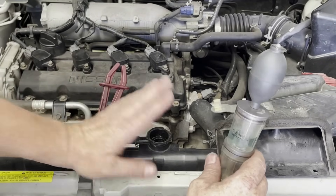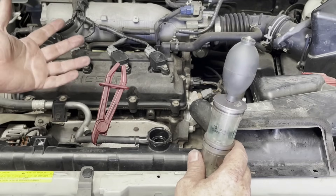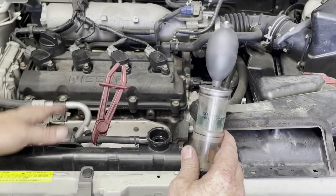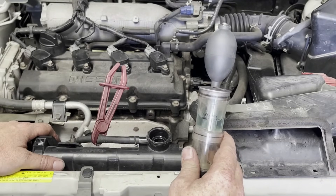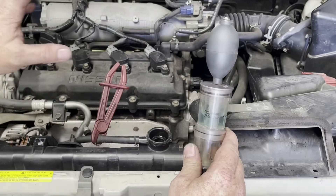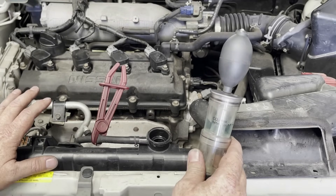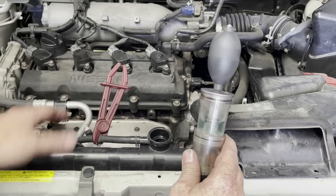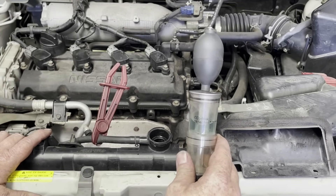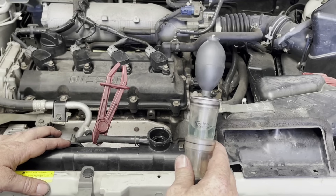In terms of a final diagnosis: it's losing coolant, we have oil that has coolant in it, we have a spark plug that's a different colour, we still have good compression so that means we've still got a good engine underneath this, and we have CO2 in our cooling system. That means we have a head gasket issue. If this had an EGR cooler you could get a false reading, and if we had an oil cooler you could get mixing of coolant into your oil — but we don't have that in this case. So it's definitely going to be a head gasket, it's off with the head. If you want to watch those videos, have a look around my channel. Thanks for watching — leave a comment, question or query below.